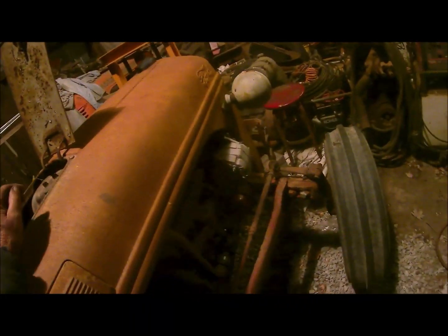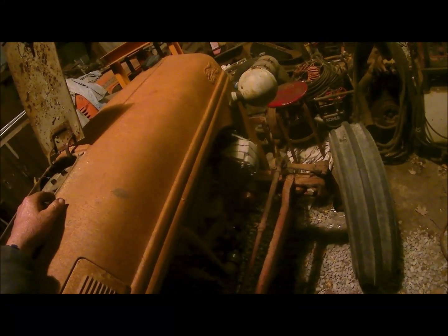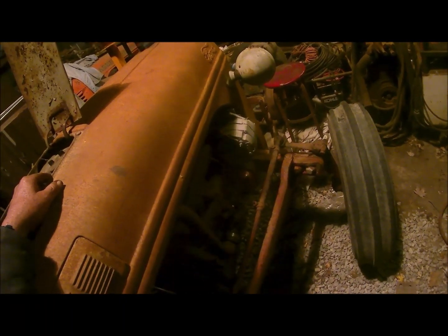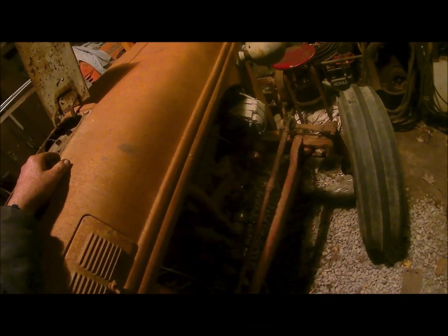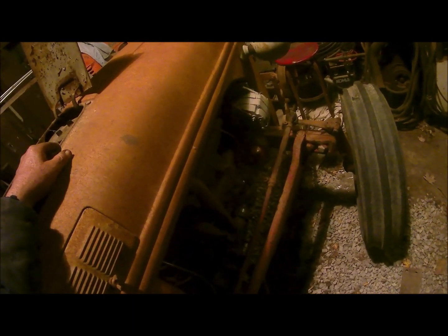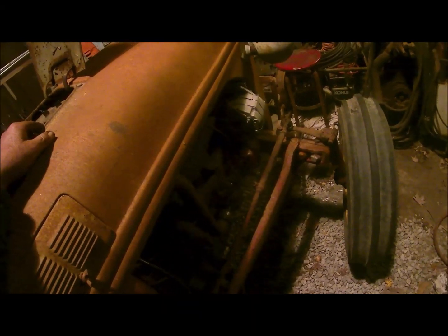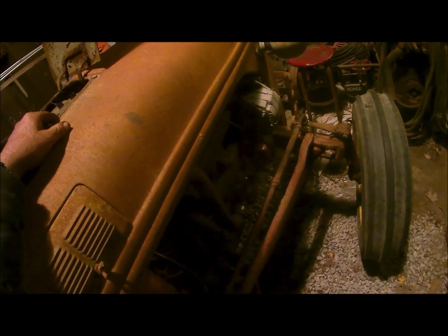What I did — I was on the computer and I just happened to see a video about rebuilding a carburetor. Now I've had carburetors apart for the last 60 some years, and I don't ever remember taking that little jet out of the very bottom of the carburetor. I took it out and it looked like a little speck of dirt floating around down in there.